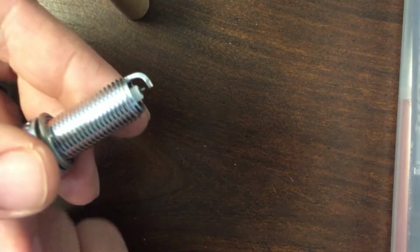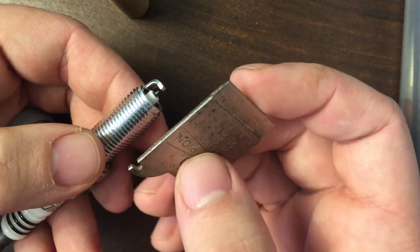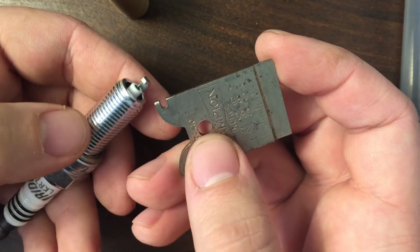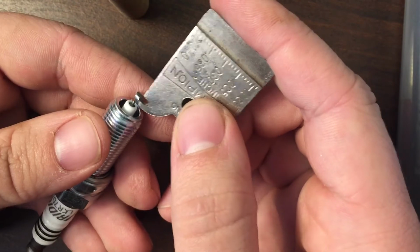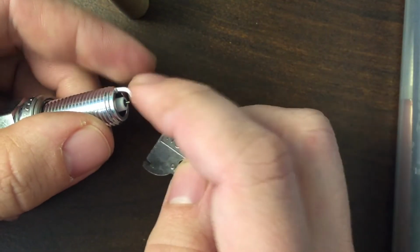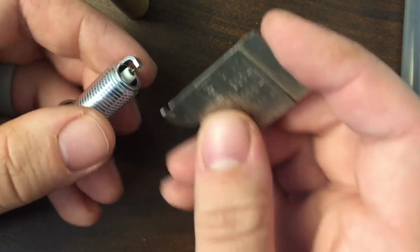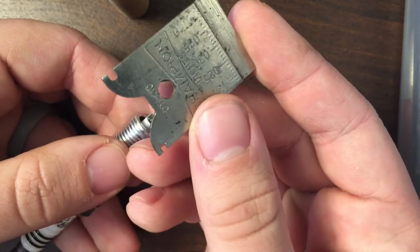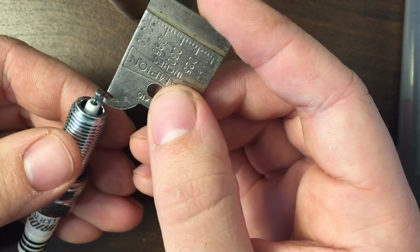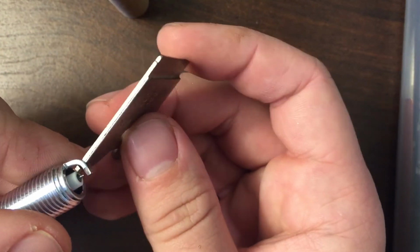So I actually have another gapping tool. There's a specific gapping tool that you can use for iridium tips, and I'll put that link in the description box below. But basically all you want to do is have some sort of leverage to bend this tip up without obviously breaking that iridium tip. So with this other spark plug gapping tool I have, you just slip this in there and then make sure you have enough clearance and then just pull back.